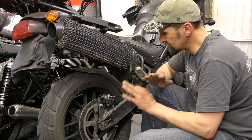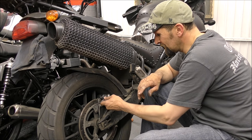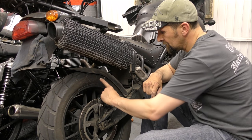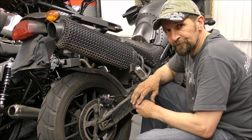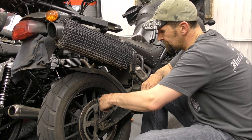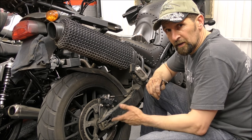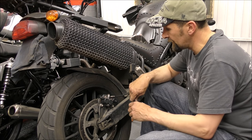Not on this earth, just do them up gently. Don't lean on it, monkey boy. All right, all you need to do, two fingers, or finger and thumb, do them up till they seat, jobs are good. That's it. You can lean on them, they've probably got a torque setting, lots of luck getting them out. So many years I've done this, I've had grief getting them out, I've drilled them and buggered up calipers, and I've spent hours trying to get them out, and now I've found the right way to do it.